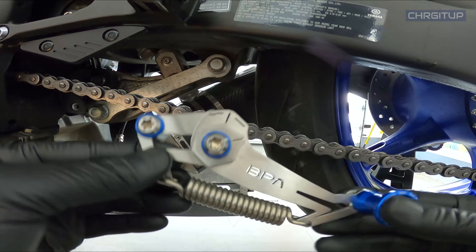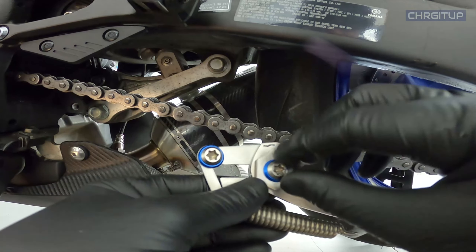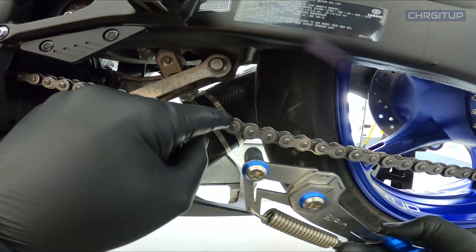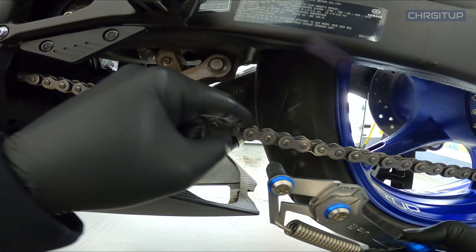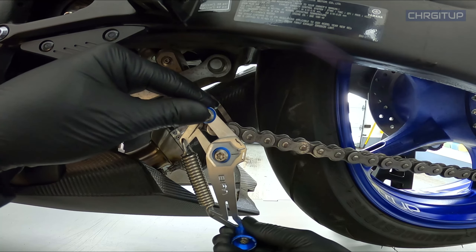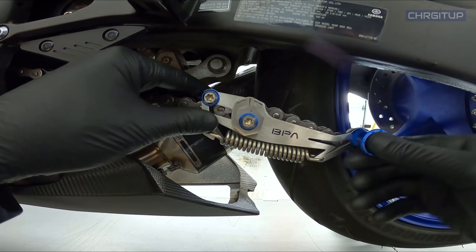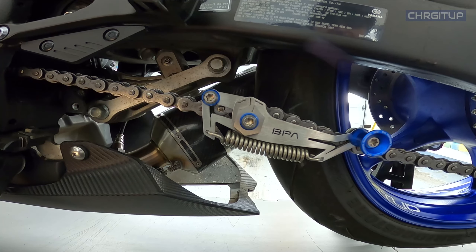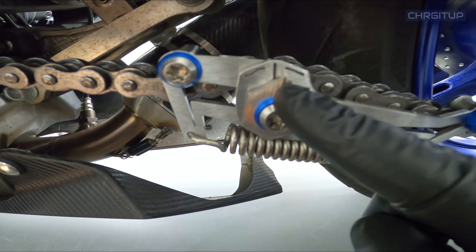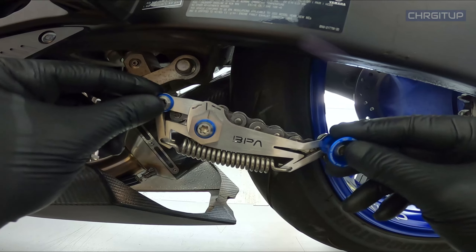This is the tool as I showed you when I took it out of the box. What we're going to do is mount the top bushing in between the chain right here — we're going to mount it on the chain's inner link. So it's going to go on the inside of a link like that. Then we're going to lift it up and by hand actually lift it onto the chain like so. As you can see the top bushing is on top of the chain, and there's a bushing in between that goes under a different link. That's a neat idea — it's actually pretty cool.